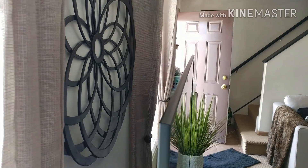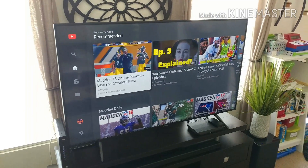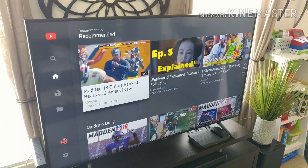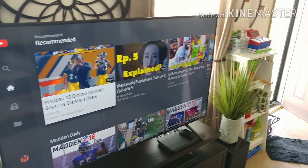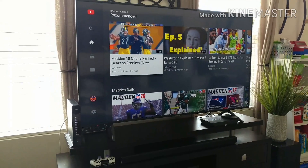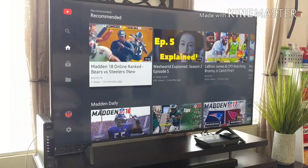It wasn't what I was planning on doing yesterday — buying a new TV — but I gotta say I'm pretty happy with it, it's a nice color. Again, this is the UN65NU7100. Remember, all the HDMI cables are 2.0, but the good thing is all the HDMI ports have UHD color, so that's the HDR — they're all capable of doing HDR on all three HDMI ports, but they're still 2.0 ports.